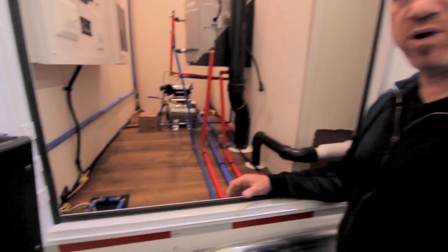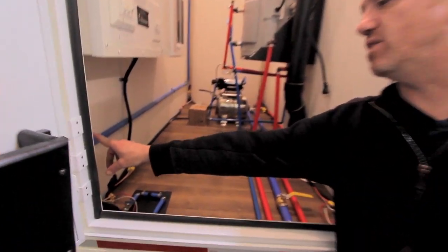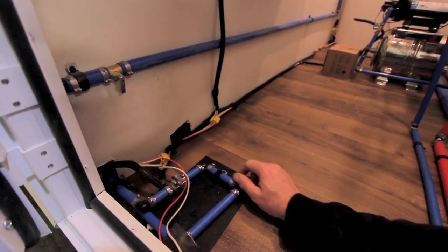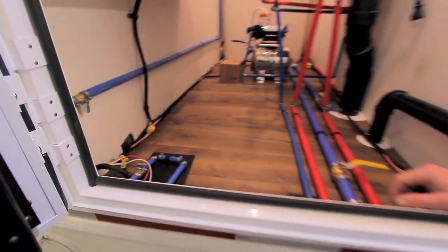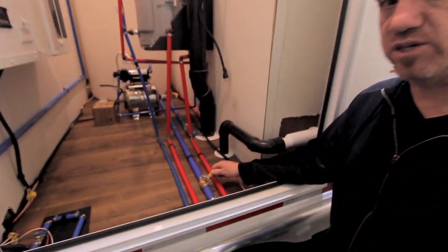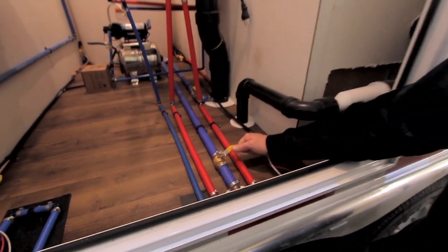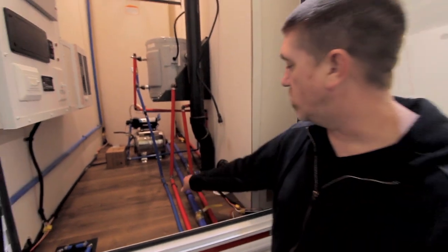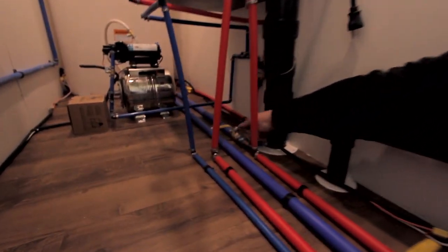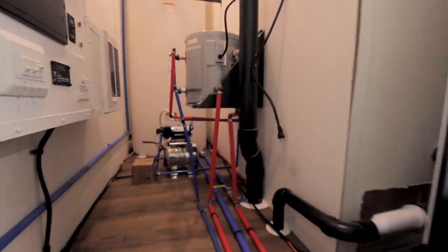You've connected your fresh water on the exterior — you've got your garden hose so that we can fill your fresh water tank, and that valve is going to be located right here. If your fresh water tank is full and you do want to drain that, you've got a valve here that will allow you to drain to the exterior — this is just going to drain right out onto the ground if you open this up. And if you open this valve up here, this is actually going to drain right into the vent pipe, which is going to go down into your waste tank.